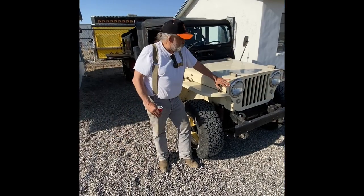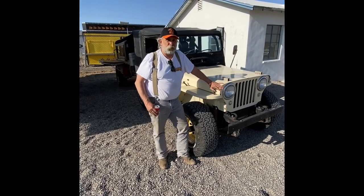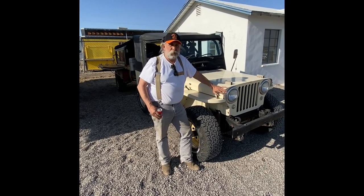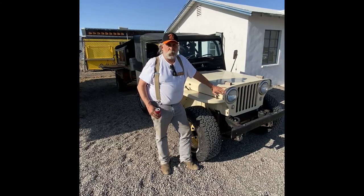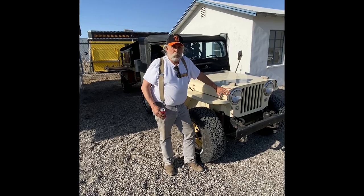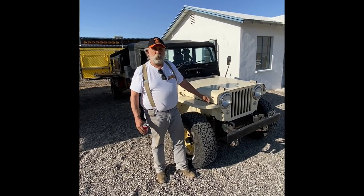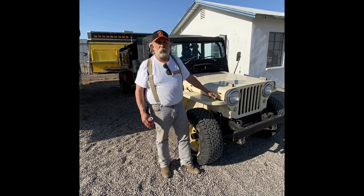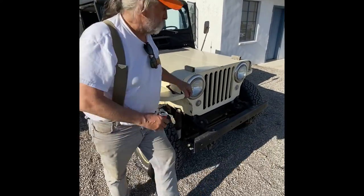All right. This is my '51 CJ3A. It's got a bit of hot rod history. It got its first V8 stuffed in it in 1957. It was a 3/8 overbore by 3/8 stroker flathead Merc. Wow. Then it got a Studebaker V8 in it. Then it got totaled in '61. My uncle went as far as to put another set of frame rails underneath it. It sat in his garage until I bought it in '72, and it's had a whole bunch of Chevrolets in it since. Wow.